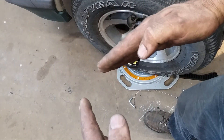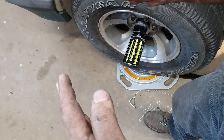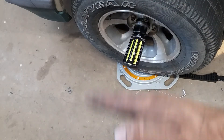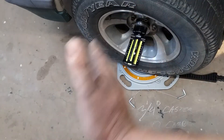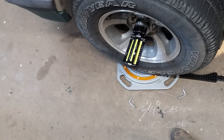If you've got too much toe-in, it's road crazy. When you turn with too much toe-in, it really wants to dive and jerk in the direction you've turned, but it stops pretty good. If you've got not enough toe-in or a little bit of toe-out, the opposite happens: when going down the road straight it is constantly fighting, because it's trying to go uphill, downhill, uphill, downhill. That's the best I can describe how to know if your toe is good or not, because a tenth of a degree from the book doesn't translate well to 25-year-old worn-out rigs.